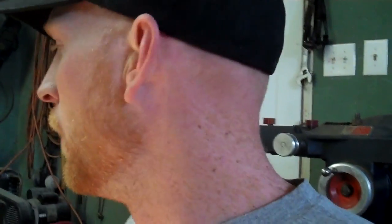You can see this one's blown open. When they blow open, they not only lose their lubrication as the grease gets flung out of there, but also a bunch of water and dust and dirt gets in there, and it causes it to deteriorate the quality of the joint. It creates a rattle, a little bit of a groan. Eventually it will become so bad that a joint will come undone and your car won't go.